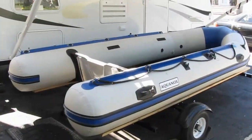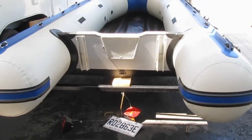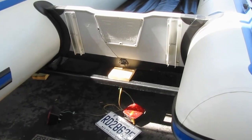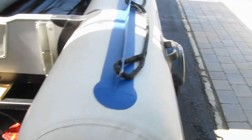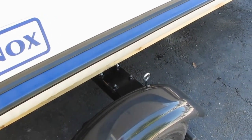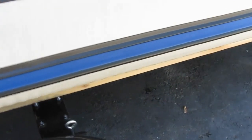The project is now complete. I did have to take the lights off the back to be able to paint the steel angle iron, so those will have to be put back on shortly. I want to give another coat because it was raw steel and will rust very quickly. Same goes for the stainless plates that were used to mount the torsion axles onto the two-by-two tubing — everything that was raw steel has been painted that is not galvanized.